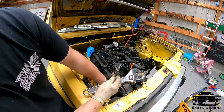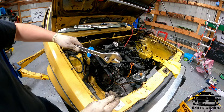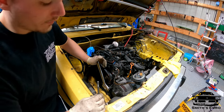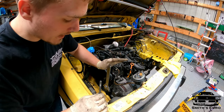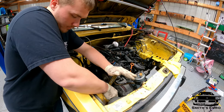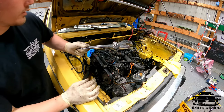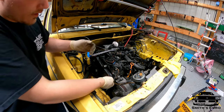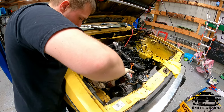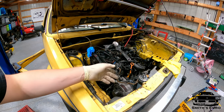You can't physically get a 13mm socket on the tensioner anymore, so what I always do is use one of these big adjustable wrenches and pry off of there. It's really dangerous because if you slip you'll break your fingers, so you've got to be super careful. The bolt is physically in the hole — I just got to tighten it up. That worked out great — I've got plenty of thread engagement on both bolts. Now we can throw the belt on.